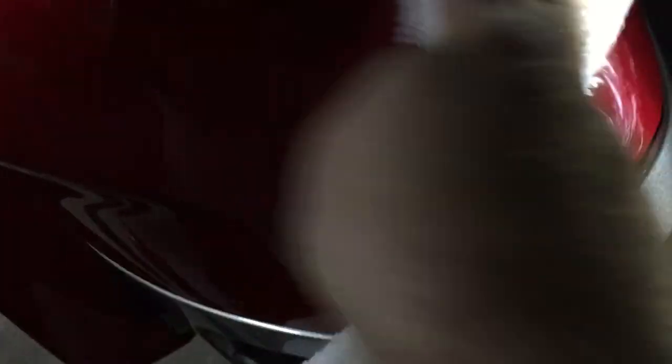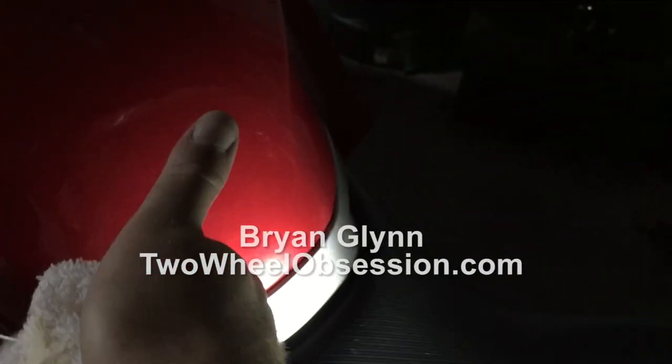And there we go. Now we just apply a little wax to seal the area back up — it should be right as rain. If you have a more severe scratch, you'll have to go with a more aggressive compound, but the point is to work your way from gentle to aggressive. That's always safe — you're never going to do damage by going too gentle. If it doesn't get everything out doing it by hand, start with a random orbital and buff when it dries.